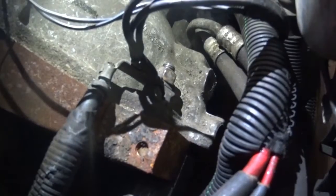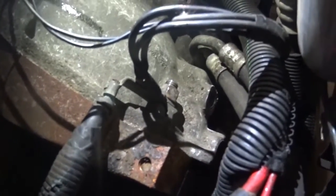I wanted to do this with you guys — I'm sorry about the visuals. Now that I don't have to get two hands down there I'm going to try to shove the camera in to show you this ground. There is some green on it — some oxidation on the surface. I would recommend the cable but they're not going to do it. What I am going to do is suffer through taking this back apart and put some copper anti-seize on it and tighten it back up. But this is a fix.